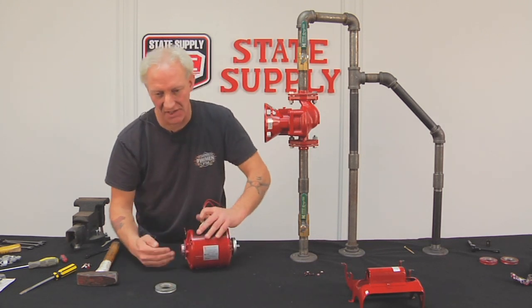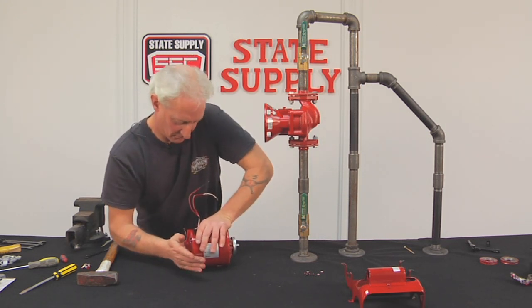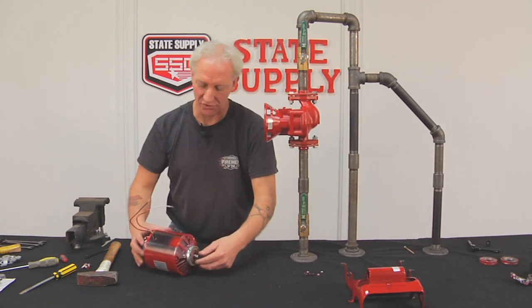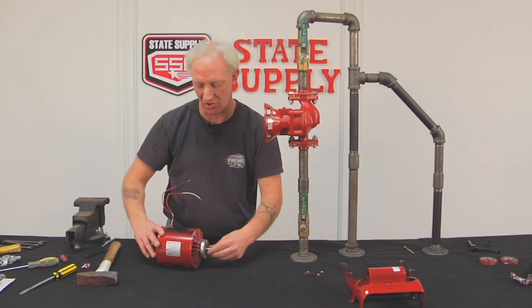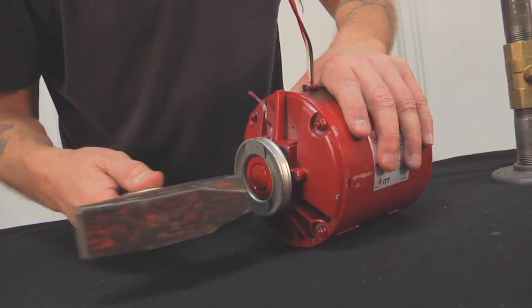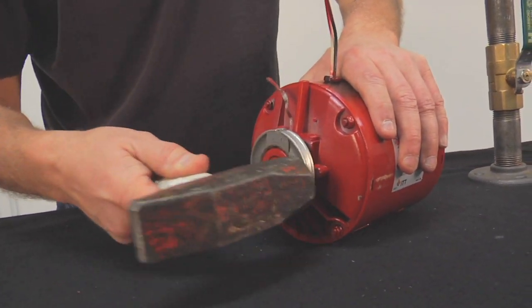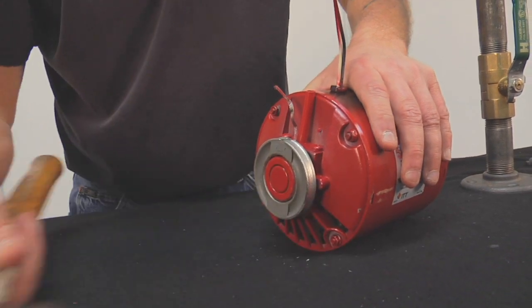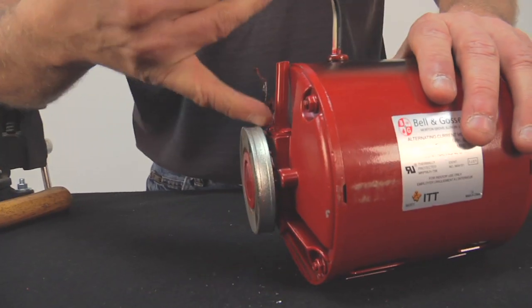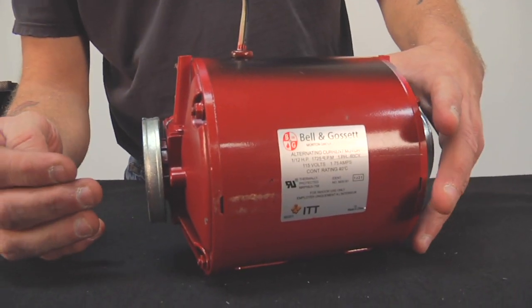Seam up, reinforce bars at 6 and 12 o'clock. Just get it pressed in place. For this one, I don't like to tip up because you have the motor shaft — you don't want to ruin any bearings. They are sleeve bearings, not ball bearings, so this is going to float. You don't want to hurt the shaft, so leave it down on the table and do it this way. You'll notice the tone change once you start hitting the end bell of the motor — you'll know you've gone as far as you want to go. This gap is normal; it's not going to hurt a thing.